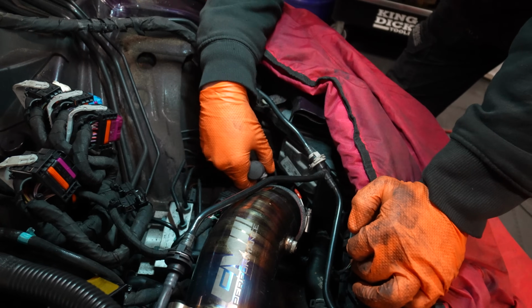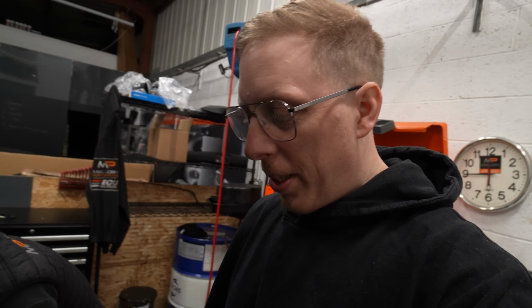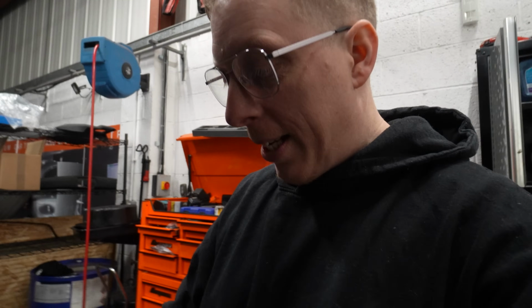That just snapped. Yeah. Rough. That snapped. Happy days. So happy days. They've cross-threaded the bolt, which has now left it snapped inside the aluminium housing. So this just seems to be the car that just keeps on giving. That bolt is either the wrong bolt, or it's been cross-threaded, or it's been sent way too strong in because it's just a cap head, and that has actually snapped. So that is now possibly a charge cooler off job, which isn't fun. So a simple map sensor change has turned into a nightmare. Typical Friday.